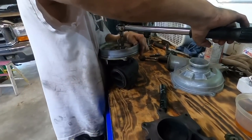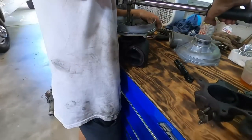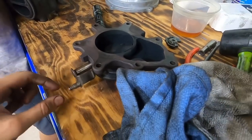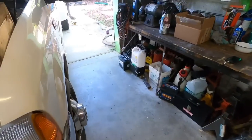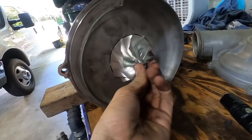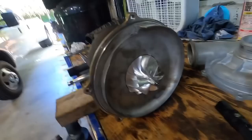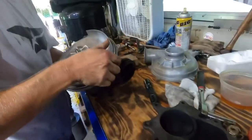We're torquing down the compressor hold-down bolts. We looked up the Ford factory spec - these are 12 foot-pounds, four of them, in a cross pattern. If you're not familiar, cross pattern is the best way to do it. Frank's working those around nice and easy. We're going to get the compressor housing on next. Frankie decided to leave the EBPV delete for now since we're running short on time - we'll just get this back installed and do that another day. We've got a couple other parts to finish degreasing and a cool pipe and clamps, then we should be ready to fire it up. Just missing the compressor housing - the final product looks pretty good. Very time-consuming but we're pretty happy with it.